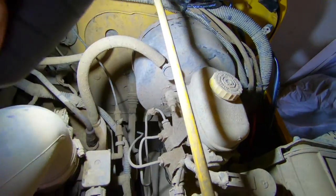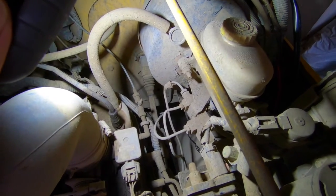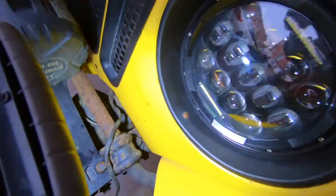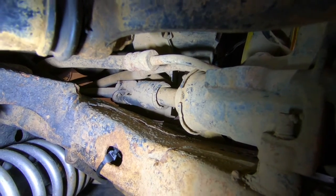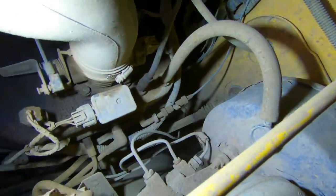Right next to your brake booster, open your hood and you should see the steering shaft rotating. That connects all the way down here to your steering box, which sits basically underneath your bumper. You can see that steering shaft — your input shaft — moving right there. What you want to do to check for slop in your steering box is get someone to move the steering wheel for you and see how much the shaft is moving on this end.